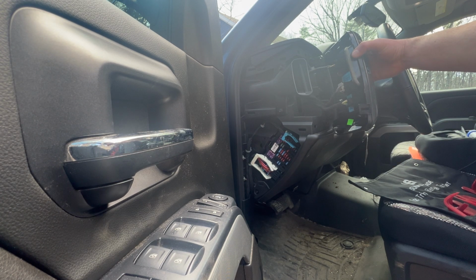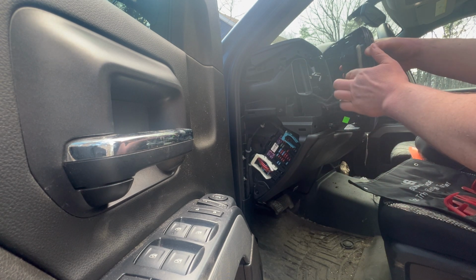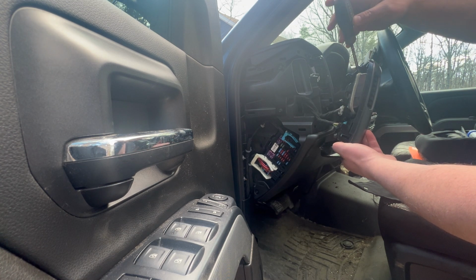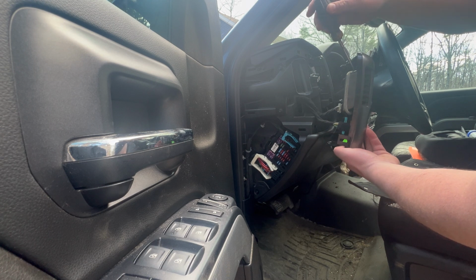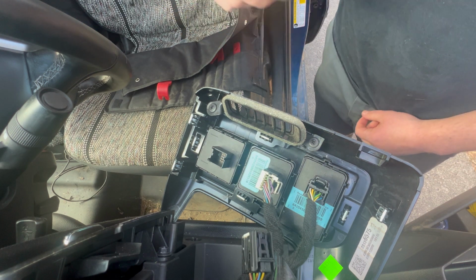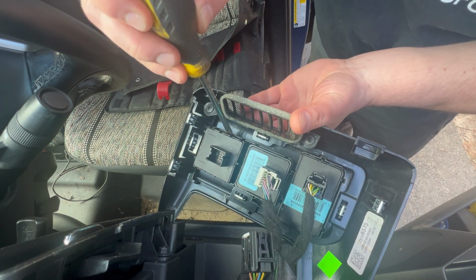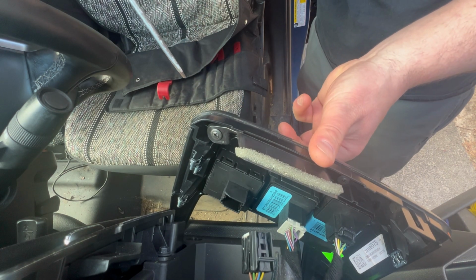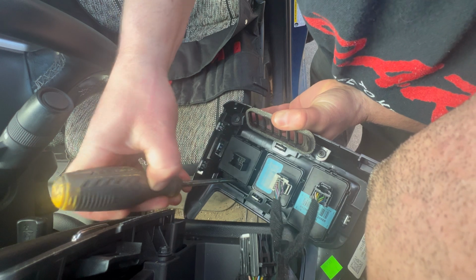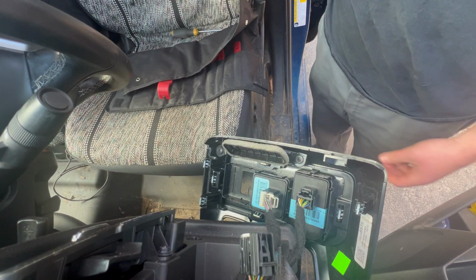And then the next thing you want to do is take out the wire connecting the trailer brake controller switch. And you don't have to mess with these. After that, this is where you're going to need your screwdriver. I'll change the camera angle so you can see better, but there's some clips back in here that you get the screwdriver under and then it pops out. Okay, now I had to change the camera angle so I could use 2 hands. So like I said, you want to get these lower clips in here, and you can kind of push from the front while you're doing it. Just like so, that's that side. The other side tends to be a little bit tighter, but that's it. There's your switch out.